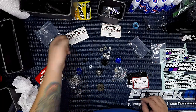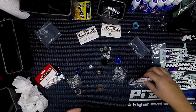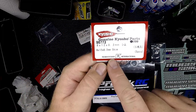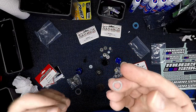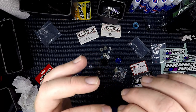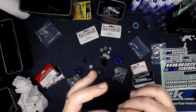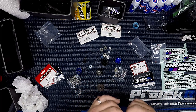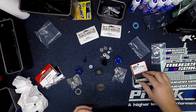Inside that differential kit I showed you comes a brand new crown gear, which is nice to have. For the crown gear I use these 8x12 shims — 8x12x1 and 8x12x2. That shim looks like this. You apply them like so; I like to use two so the shims have something to work off of. You put this in your differential case, attach it in, and then test your differential motion for notchiness.